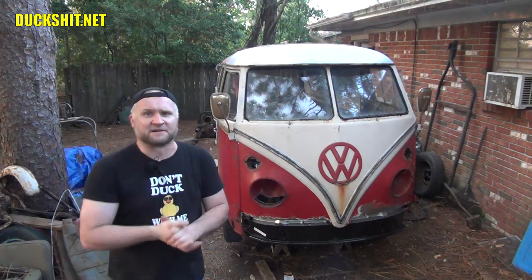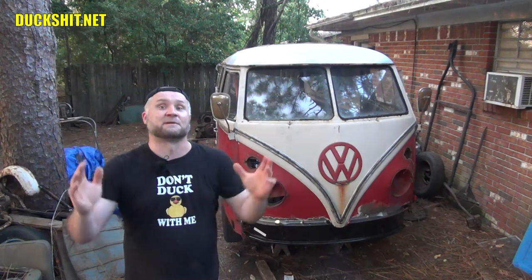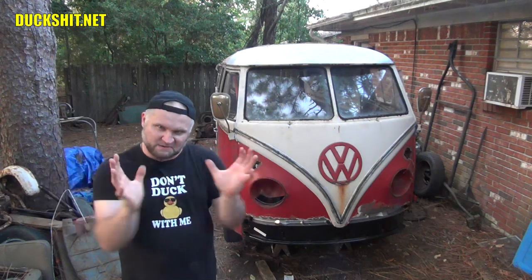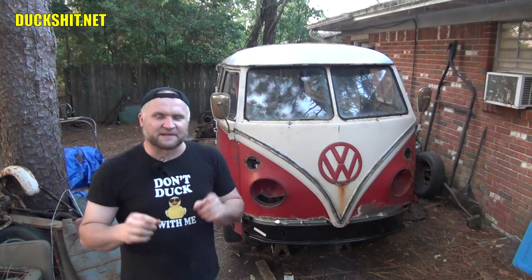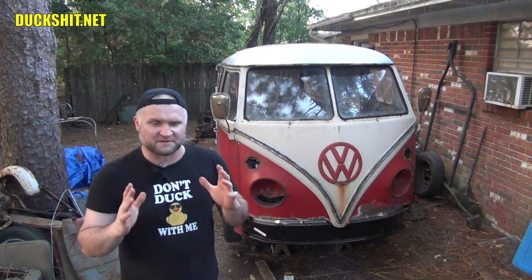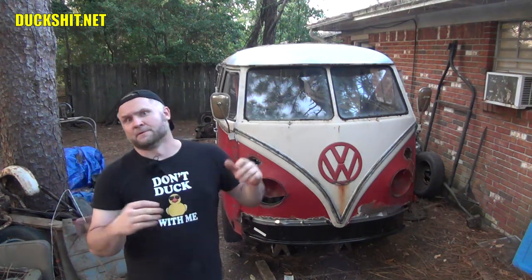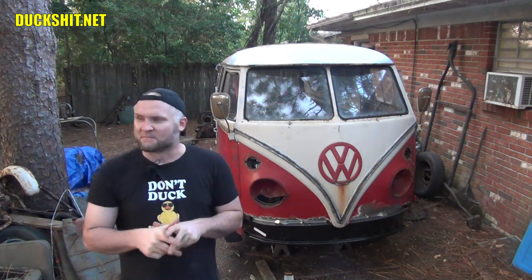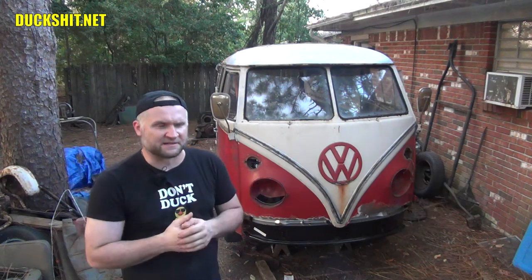What is IRS versus swing arms? With swing arms the wheels do this when you go over bumps — they just naturally move that way. I can feel this when I'm driving in the fastback. It's a weird sensation — it feels like you're being pinched and squeezed and pinched and squeezed. You can actually feel it. The suspension will actually sit a little high or a little low as the wheels finally settle to where they're supposed to be. Some people say your shock absorbers are bad — no, it's got good shock absorbers, they were even changed at some point. But comparing that to driving an IRS, it's just a completely different animal.